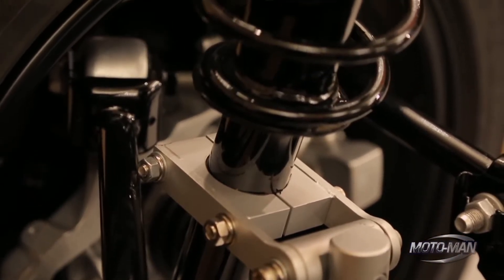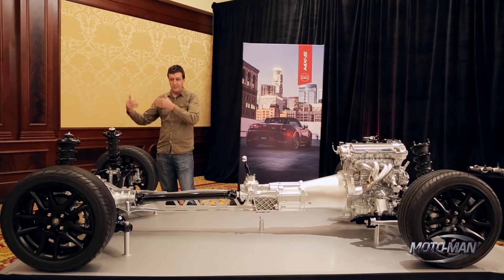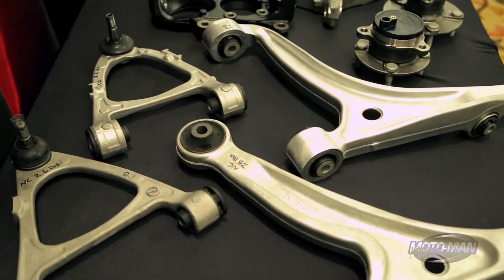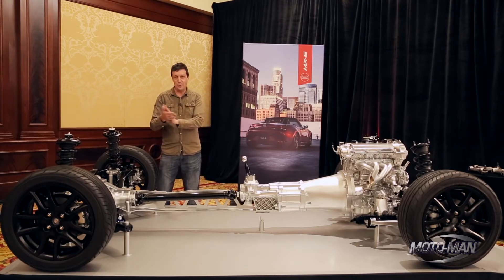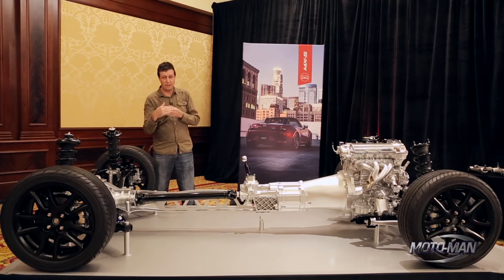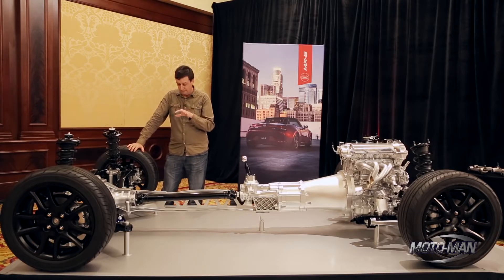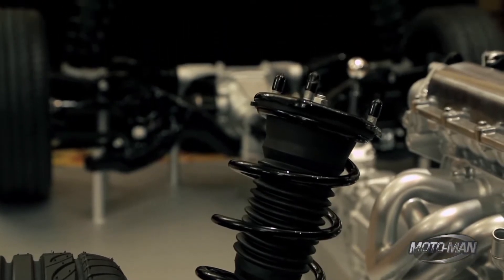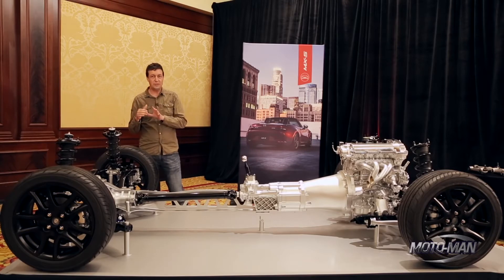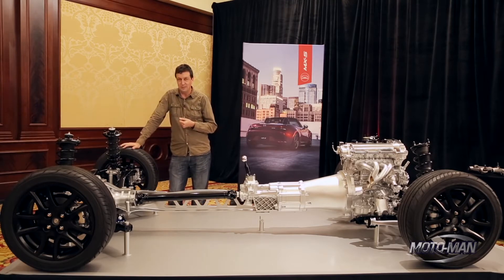We've got two kinds of passive steering in this rear suspension. One is compliance steer — we've got all these rubber bushings, all tuned differently, and the way they comply when you put a side load on the tire can cause the tire to toe in or toe out. We also have kinematic steer — as the suspension travels up and down, it steers in or out. With the previous car, we had compliance toe-out that would throw the car into the corner, then it would roll and toe in to stabilize — very nimble but a little unsettling. On the ND, the compliance steer toes in a little, and as the body rolls it toes in a bit more. Both effects are very subtle, giving the car very linear behavior, strong rear grip you can count on, and a neutral balance through the middle of the corner.